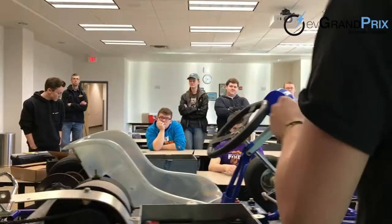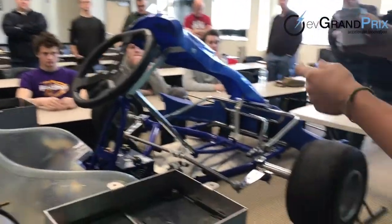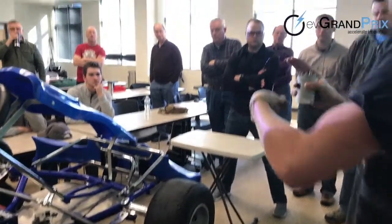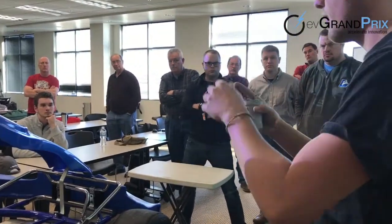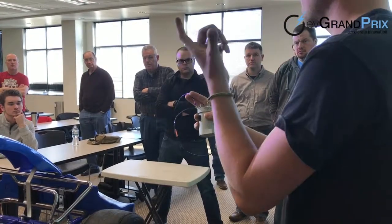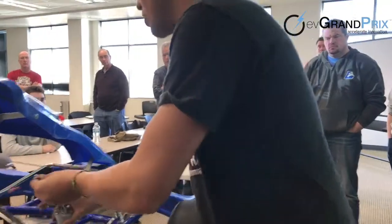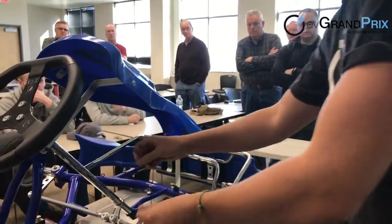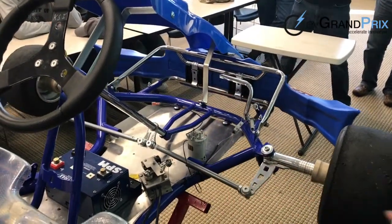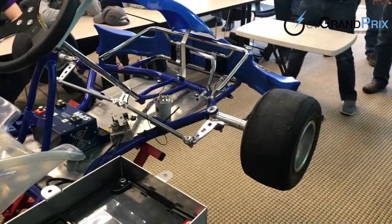This contactor is what connects the battery to your system through these wires. If this coil gets 48 volts through it, it'll push that bar up and connect the battery — that's the turn-on within the system. Physically, you're going to take these two wires and run them throughout your cart. I personally call it the safety circuit, or the turn-on circuit — they're kind of one and the same.